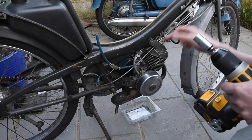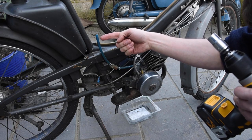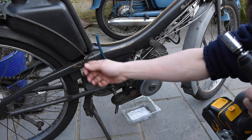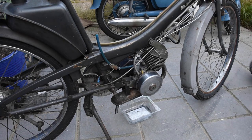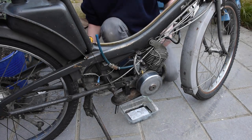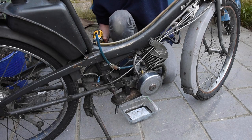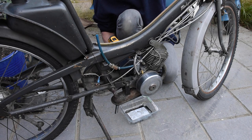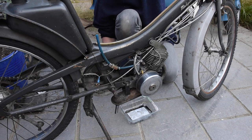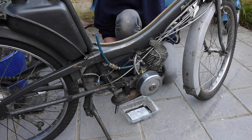Right, so spark plugs back in, connected. All connected. I filled the fuel line up. I pulled it off the bottom of the tank and filled the fuel line up with some two-stroke mix. I wasn't sure what this one takes, so I've played it safe and put a little bit extra, so it might be a bit smoky if it starts. Okay. I believe this one up here is an enrichment lever, which is like a crude choke. So I've got a drill on the side. Here we go, that enrichment in. And okay. Ooh! There you go.